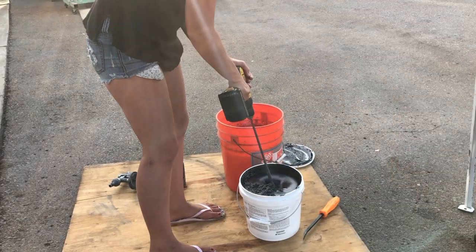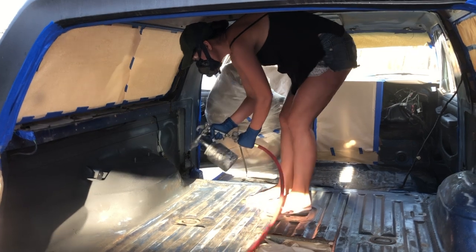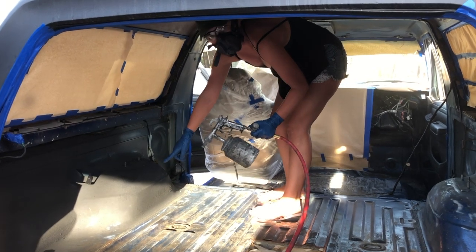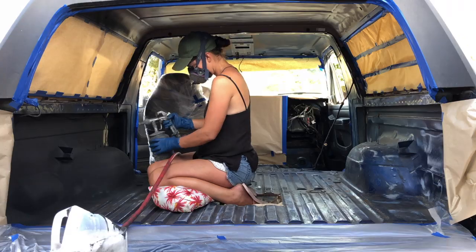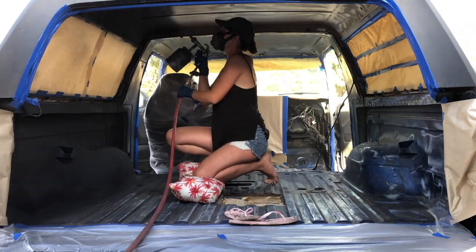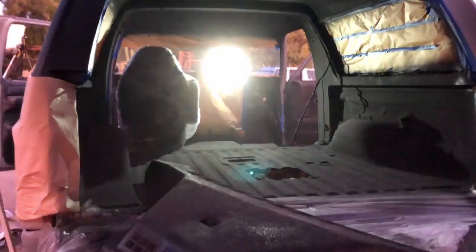As you mix it around it activates it. I read that it can be stored for six months to a year if you have some leftover that's already been activated. This is where I regretted not sanding more on those wheel wells because the glue was showing through. I was using an old gun and it just kept getting clogged, so Jared would have to clear it out with soapy water every 45 seconds it felt like and give it back to me. Took all day. If you've got big heavy glue, sand it down — it's worth it.